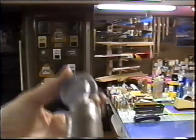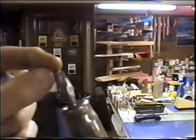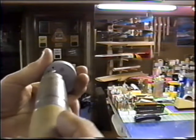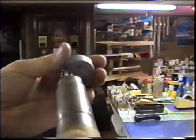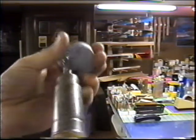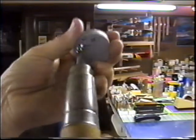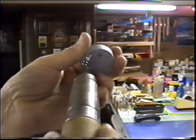Another thing I like to do, I don't know if anybody has these, you can buy them in machine shops, and it has a drill, or you can use a countersink. But I always like to break the edge of the hole. What happens if you don't do that? When you go to wipe the airplane off, needless to say, you always wind up hooking a paper towel on it or something that makes it a little inconvenient.